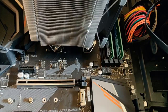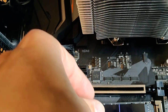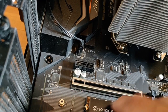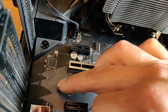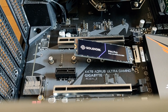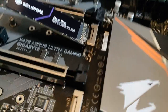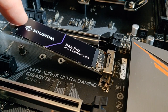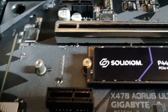Usually the components are on top for the cooler, so it goes in like this. I have already placed the standoff in the back — here is the one standoff to attach the solid state drive, and here is for the heatsink with the different screw. When you mount it inside that slot, it goes in at a little bit of an angle. You really have to push it down to mount it. This is normal — don't be scared about that. So this is what it looks like when it is inside.